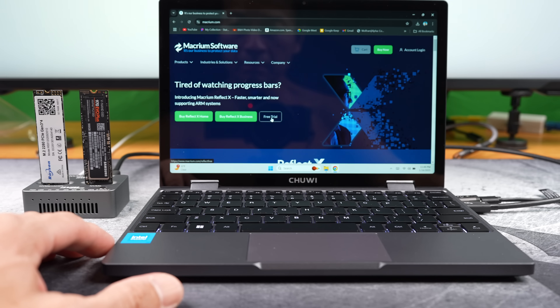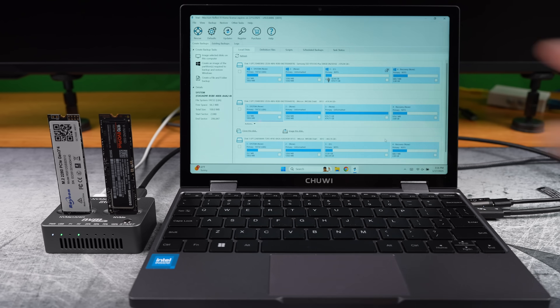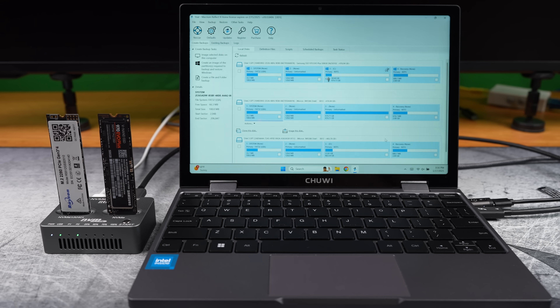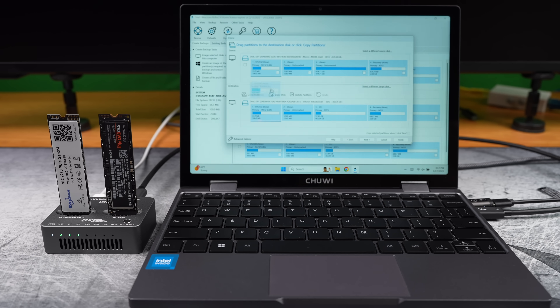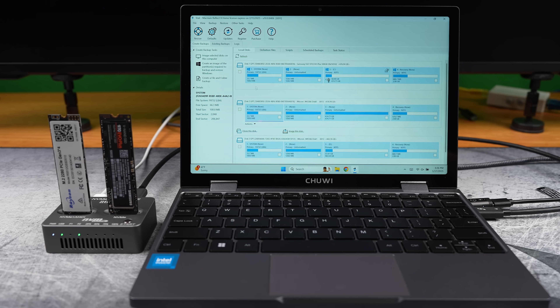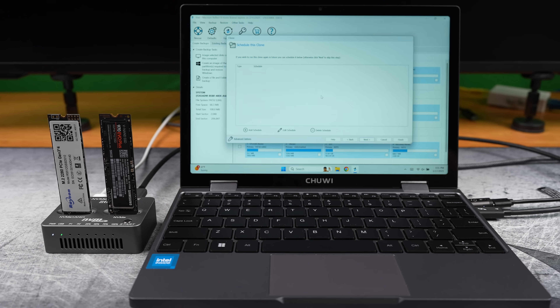Now I'm going to use the cloning device as an enclosure for the real Samsung drive and perform the cloning process using Macrium software. Disc 1 is the fake drive inside the laptop right now. Disc 2 is the original drive that came with the laptop. And Disc 3 is the real Samsung drive. I attempted to clone the original drive onto the real Samsung drive several times, but it didn't work because the main partition of the real drive doesn't have enough space. So I ended up cloning off the fake drive instead — it had worked from the offline cloning earlier, so why not give it a try? And it works.